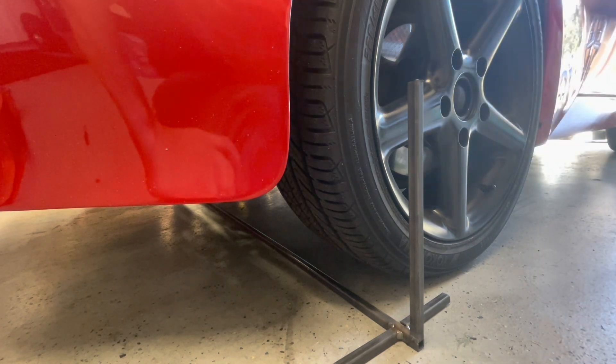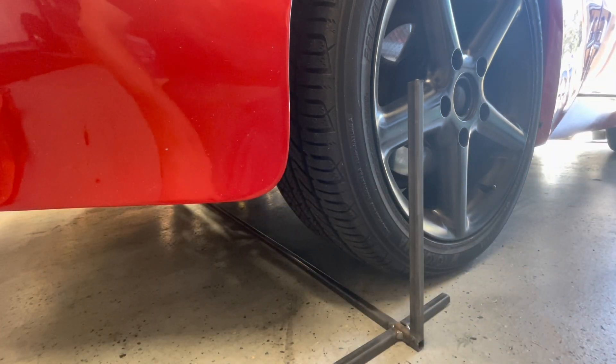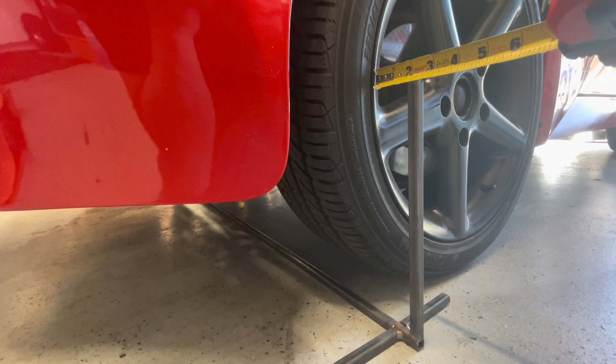On the driver's side, the jig sits under the car and we have a gap to measure. Instead of running a tape measure all the way across and guessing, we get repeatable results from each side. We measure from the front of the wheel to our jig — the overall length doesn't matter, we just want the difference between front and back. The front measurement on both wheels comes out to 1 and 15/16 inches.